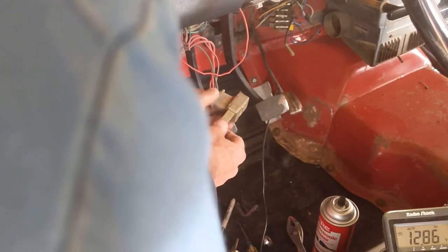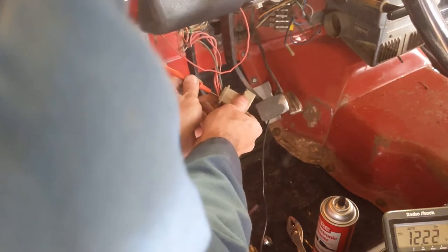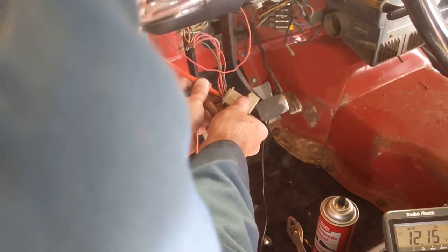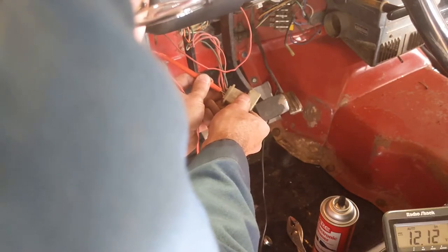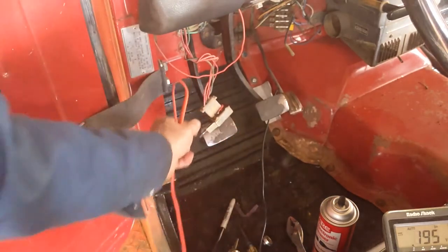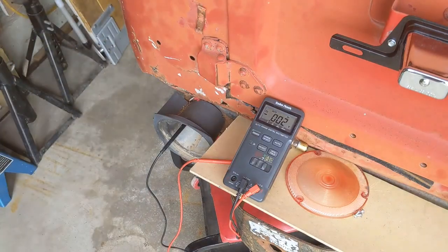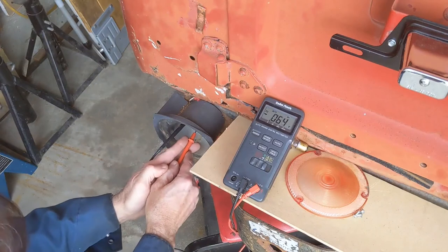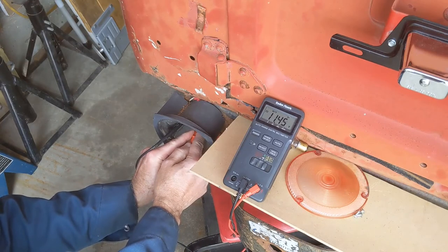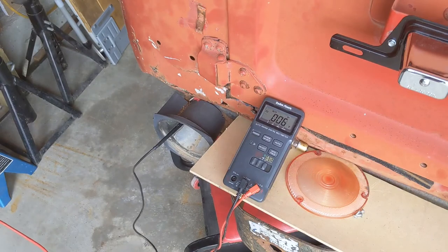The battery is on the charger — reading 12.8 volts. When I turn the lights on it goes down to 12.2 volts at the switch output — that's more like it, much better shape now. But checking at the back of the vehicle, it's still about 11.4 volts — only about one volt better than where we started, so we still have work to do. There must be more problems after the light switch on the way to the rear.